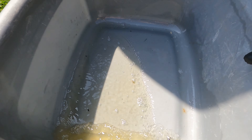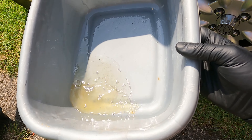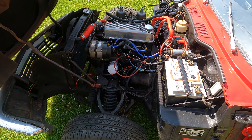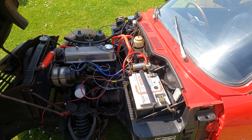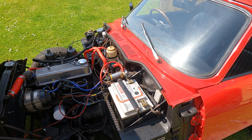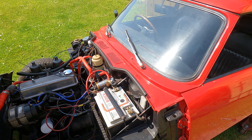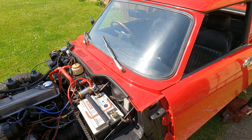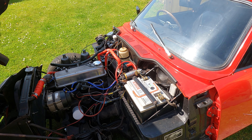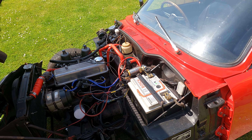It looks like a fairly new tank — definitely fitted before I bought the car, probably about eight years ago. There's a bit in there, so just as well we didn't put that back in. I'll just leave that there to evaporate. In a future video we'll tackle the sender unit, the voltage regulator, and the gauge. I'm pretty convinced the gauge is fine and the voltage regulator is probably fine too, as long as it's putting out a steady 10 volts. The sender could be stuck halfway up the tank — we'll have to drain the tank again for that. It's pretty easy to get to through the boot, but we'll do that in a future video.